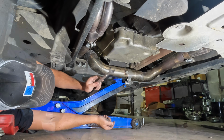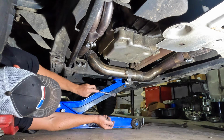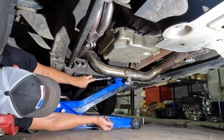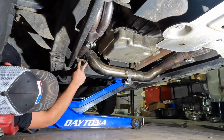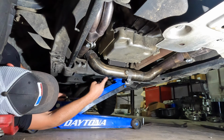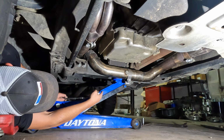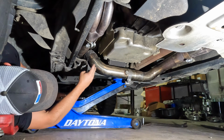Well, crap. So I forgot to hit record on my GoPro, but I went ahead and removed our skid plate. I took the 2 bolts out that connect this cross member to the transmission. I'm going to be taking these 2 bolts out, one out from that side, loosen one so it still stays connected but can swing down, and then we're going to lower our jack, hopefully drop this one side down enough to get this out, the X pipe in.